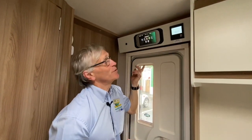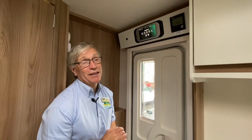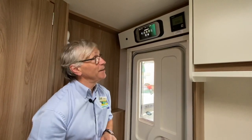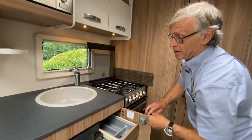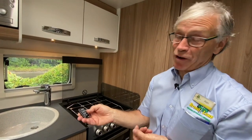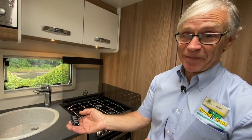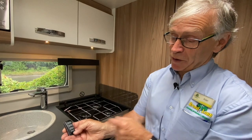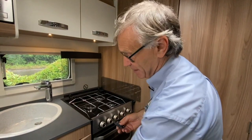The only other thing with the Swift Command: you have the option to go for the tracker. You can register for that through swiftcommand.co.uk or on the app itself. The tracker is activated from your alarm — on the caravan, you've got a tilt and internal sensor. To activate the alarm, press the second button down once — that's your alarm activated, and if you subscribe for the tracker, that's activated too. Press the button again to turn the alarm off. If you've got power on, the awning light will come on so you can override it. There is also a fourth small button — P for program — to change alarm settings. Please read the manuals for how to do that correctly.